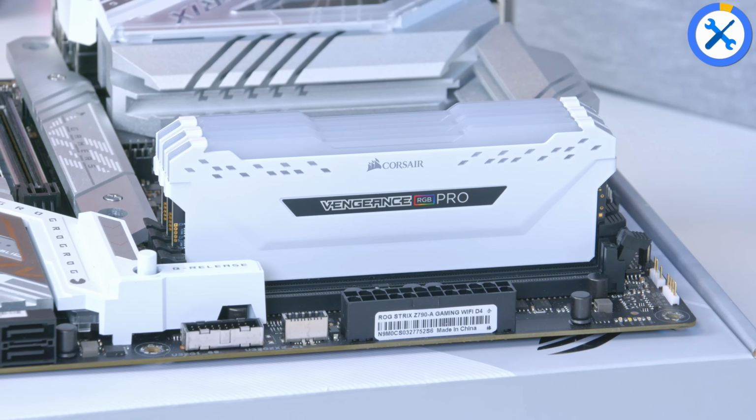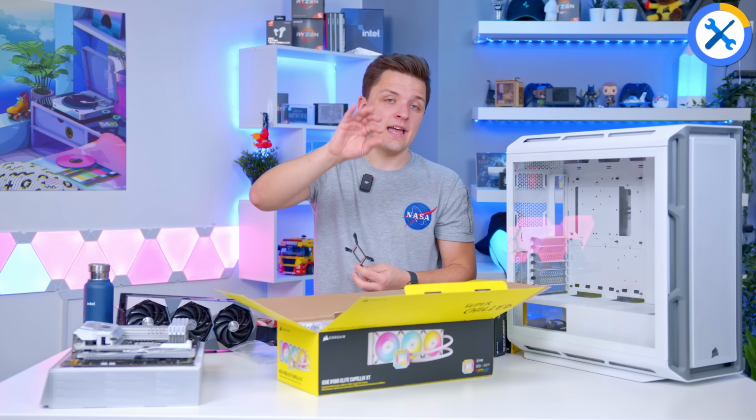And then you'll also find a backplate that looks a little something like this. That's what's going to brace the cooler to the motherboard. So take your backplate and take these screws for now. The rest we're going to save for later and deal with in about 10 minutes time. Grab the motherboard, and then on the back you'll find 4 holes. Now on some boards you might see the holes have got various iterations. It doesn't really matter which ones we use. I'm going to go for the outer ones and just adjust the backplate to the holes as we go.